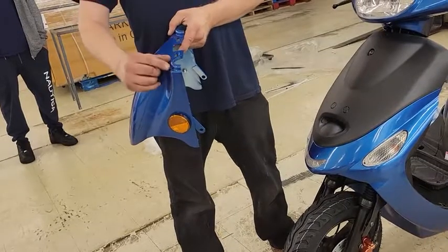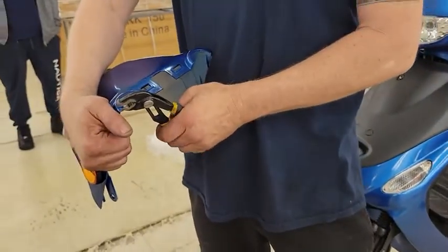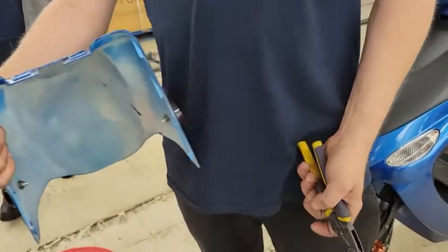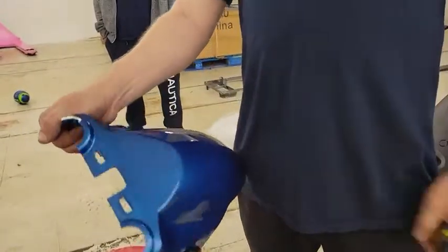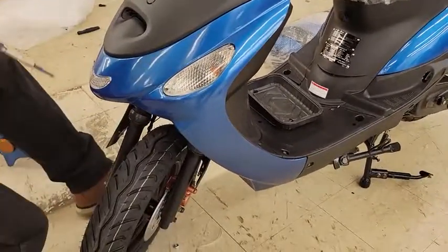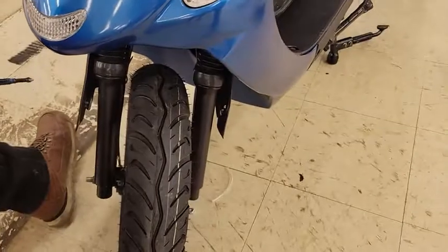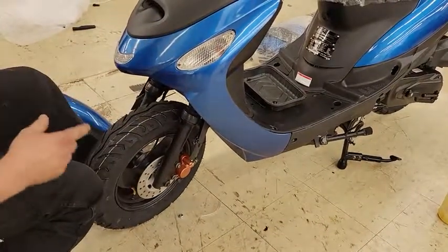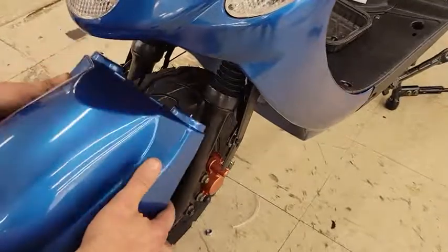There are times when you'll find wiring issues or things not working where you have to go in and fix what's wrong — the goal is to put out a quality product and China doesn't always cover all their bases. The fender tabs line up on the top of the forks — there are a couple of tabs that hook on there, and sometimes on the Solana model these are almost impossible to get on because there's not enough space between here and the fork. On the Solana model I'll actually take a pair of pliers and pull this edge all the way off to get the space I need. It doesn't look pretty but it's out of sight from the customer and they'll never see it. Then I take those bolts loose — there's also a little rubber washer associated with that, make sure you get them both to go back on. Pull them outwards to give yourself a lot of play to work with.